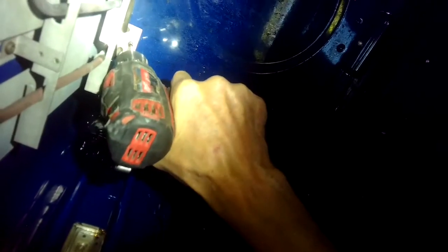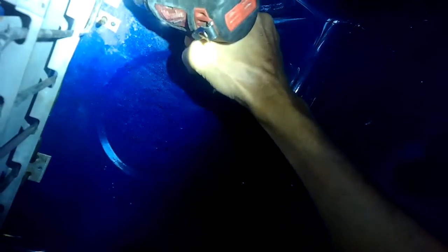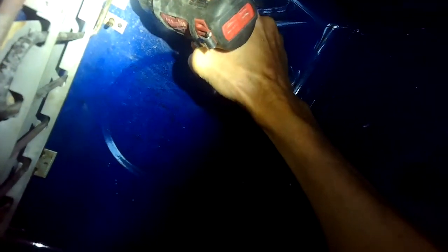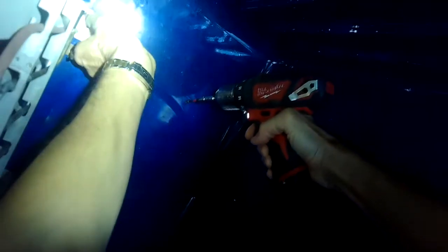You can turn off the breakers, that is the best way to do it. There are 2 breakers for your oven. We're going to take out these 2 Phillips head screws on the back firewall. They're the ones holding the back of the element in position. Take those out, and then there are 2 more that we're going to take out that are holding the element up against the top.